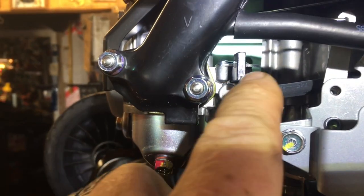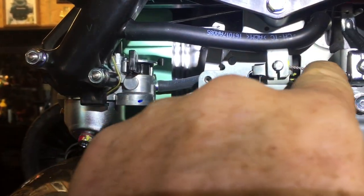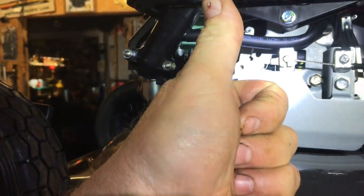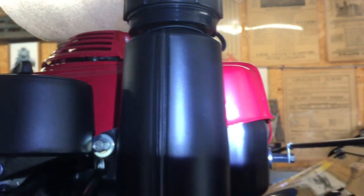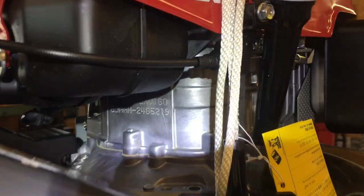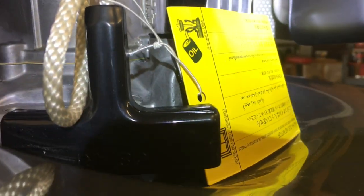Here we are with the accustomed things you see in a better quality Honda engine — the drain and the fuel shutoff to make things easy. We're going to get to that choke — it's a manual choke. You'll see that arm right on the other side of the fuel line. As you articulate the throttle up topside, you'll raise and lower the throttle on this motor. I was ready to walk right out when I went to the Honda dealer, and they said the automatic choke is gone — you don't have to worry about it anymore, it works. This is mechanical — and it will always start for you.